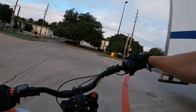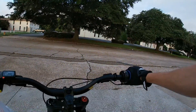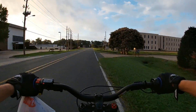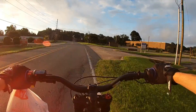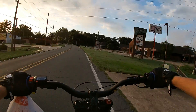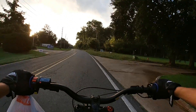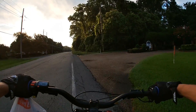Do you need to put a 62-tooth sprocket on it to have ultimate wheelie torque? No — you have wheelie torque with what's on it. It has a 48-tooth and it does wheelies easily. I'm going to go smaller on the back sprocket — probably a 44-tooth. The Shinko tire added a few miles per hour — two to three, maybe even four — and it actually gets the stock speedometer closer to accurate.